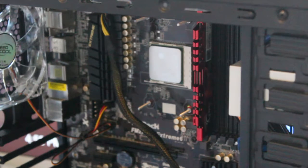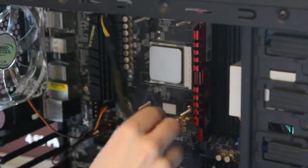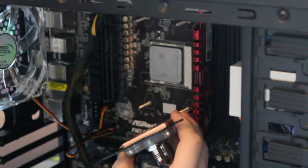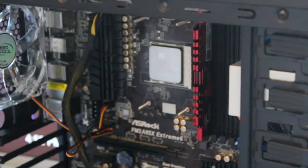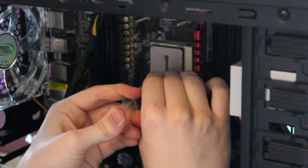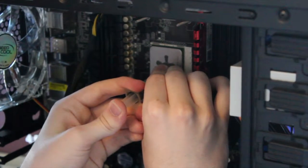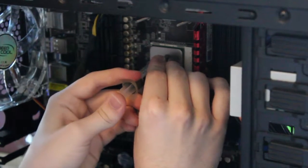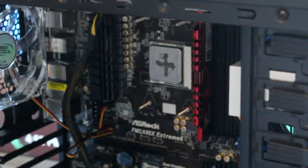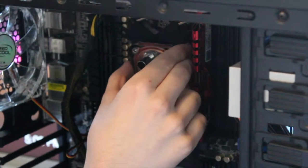All the screws are in. Down here the holes for the CPU cooler mount seem a bit bigger than expected. I almost forgot the thermal compound — that would have been a failure. Just put a nice little cross pattern on here — this is an AMD chip, this is what I did last time and it spread perfectly. Just a bit more. Looks very nice.